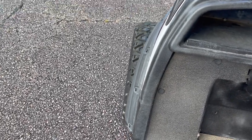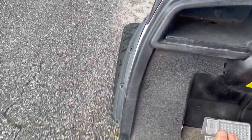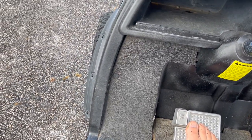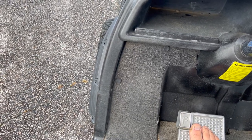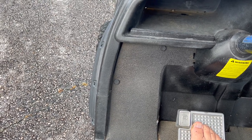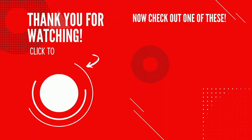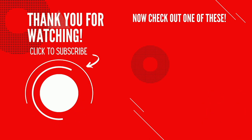So that issue's been fixed. Now we get to move on to the next issue, which is whenever you come to a stop your pedal goes almost all the way down and you have that loud noise. So that means we have to replace all of the braking parts inside the transaxle — I'll be removing the full thing, cracking it open, and replacing the brake parts. Stay tuned for that video sometime this summer. Thank you so much for making it to the end of the video. It'd be awesome if you'd click that logo in the bottom left-hand corner to subscribe to my channel, and maybe even check out one of my other videos shown on the right. I hope you guys have a great day.